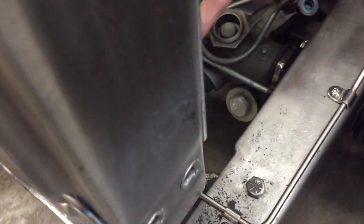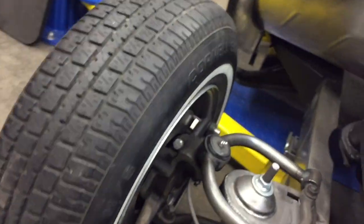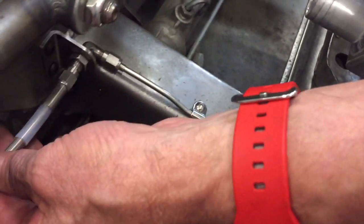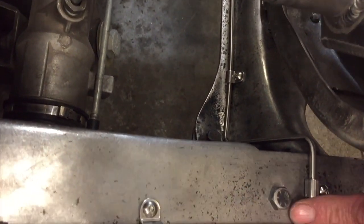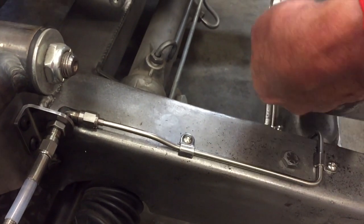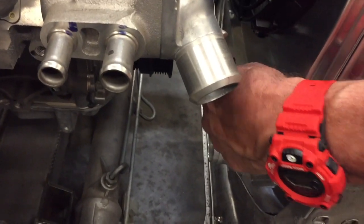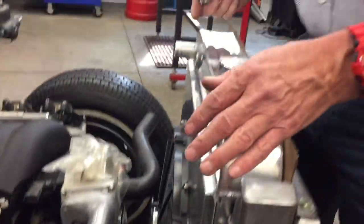From here it goes down and across to the other side and connects to the other brake line. It comes over, goes into a 90, and attaches to the flex line — super clean and simple, really happy with it. This is another place where I tried starting the bend from one end, and it was really difficult. What I did instead was measure to the middle, make the shape in the middle first, then bend out from there. Doing it from the middle helps establish the plane and cuts down on waste.